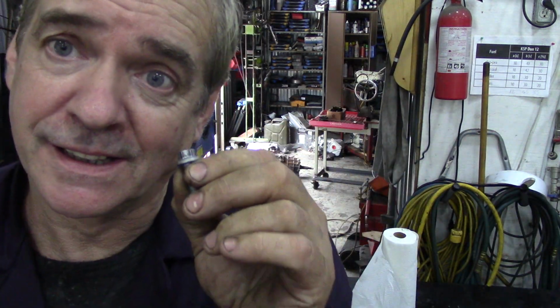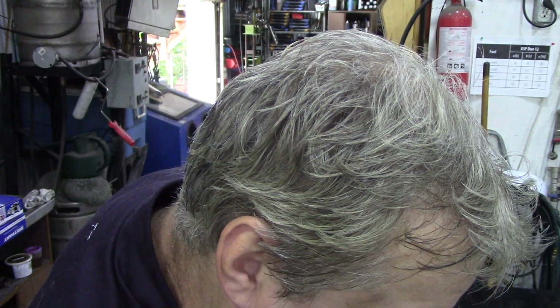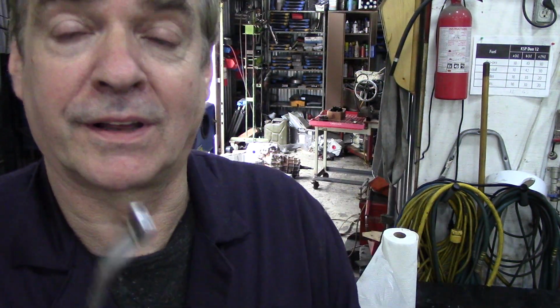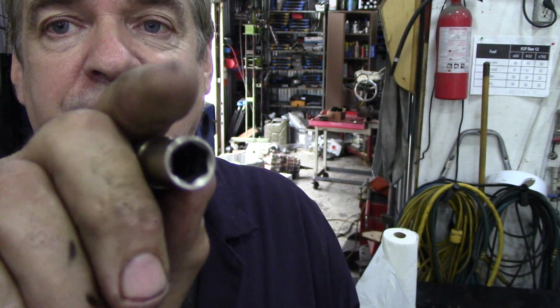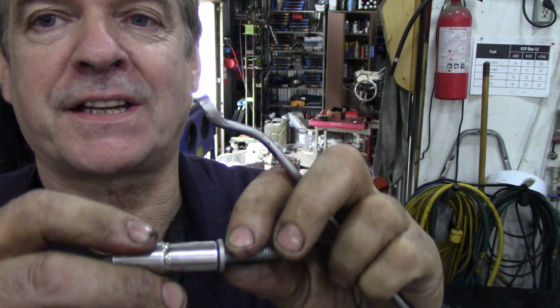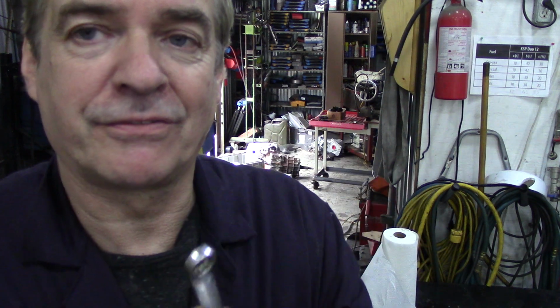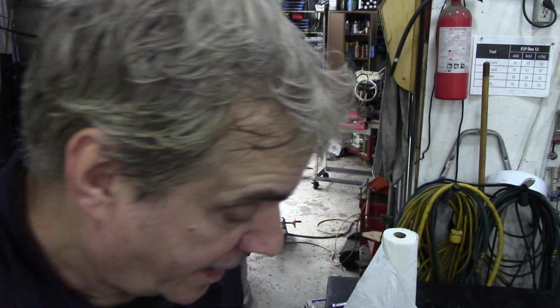The problem is, you should never loosen them off with a general ring spanner. Why? It doesn't make any sense, Mike. Because you can round them off really easily when they're tight. You should always use a single hex, like a socket like this. Unfortunately, I don't think they do any spanners, well probably Snap-on do, with a single hex, so you get that maximum surface area contact on these bolts. Once you've cracked them off and they're already loose, then you can lace into them with that. So that's one top tip on how to get bolts out.